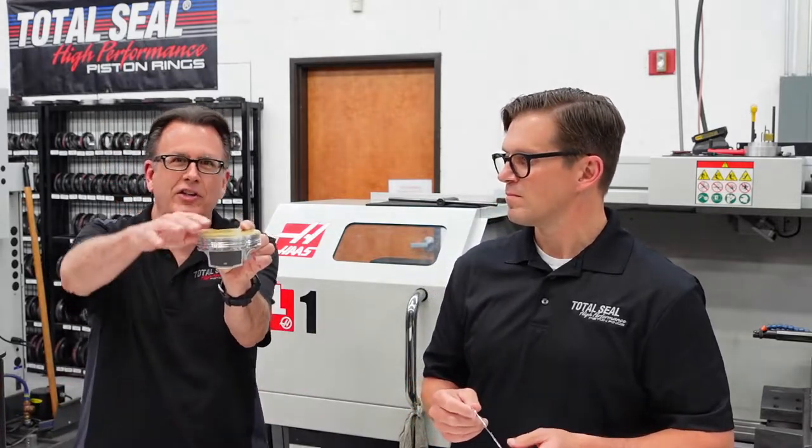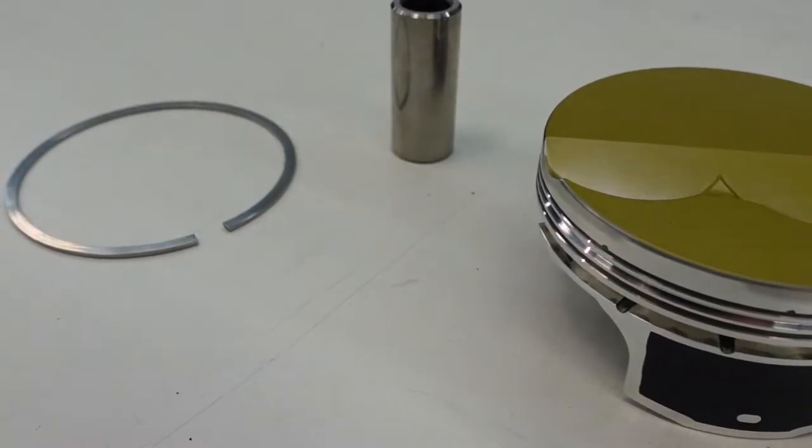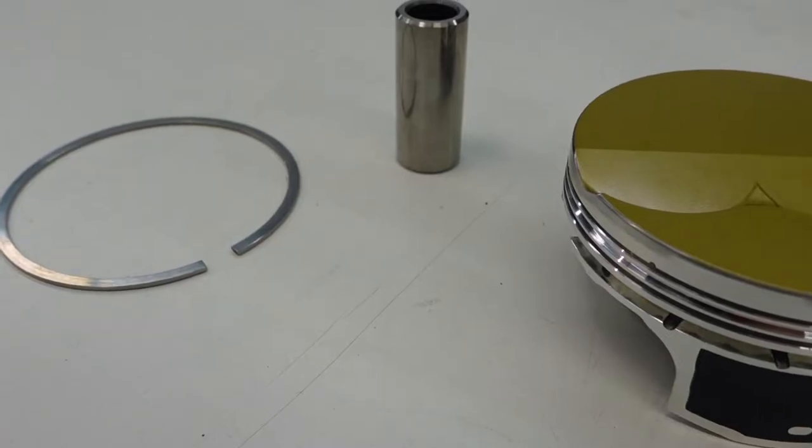The foundation. Without that pin, guess what? All this is folding, moving, bending, pinching, clamping. You need this to be a strong part. Absolutely. You know, we've got some common friends from the pro stock arena that have seen what happens when you make this too light and too thin. If it starts to go oval and not round, bad things happen. You've got problems. A house is only as good as the foundation.